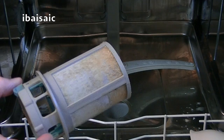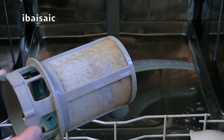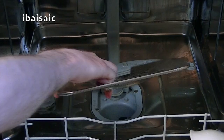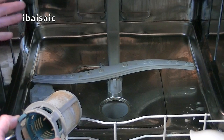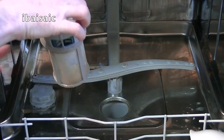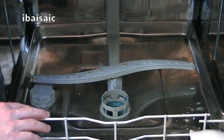This is the fine mesh filter — there's a coarse filter in there as well. That could do with a bit of soaking in hot soapy water and a little bit of a brush. I'll do that before I actually switch on. And then there's your metal mesh filter — that's fairly clean. These filters are designed to protect the pump. Because dishwashers use relatively little water — a lot of people are surprised, they think they'll use a lot of water, but they don't, because they recirculate the same water. The water goes through this filter, so it filters out any large bits. In reality, a dishwasher can use less water than actually washing up by hand.